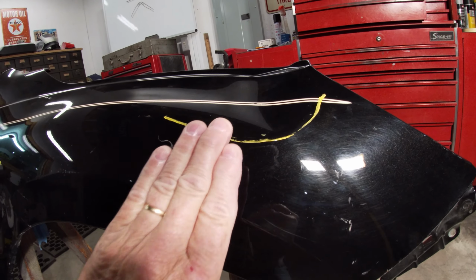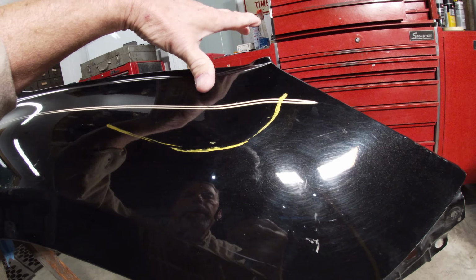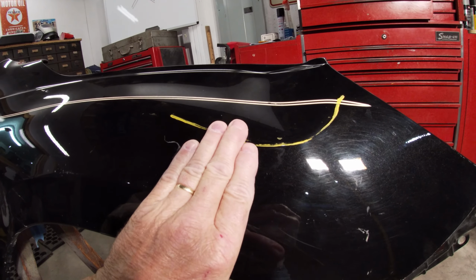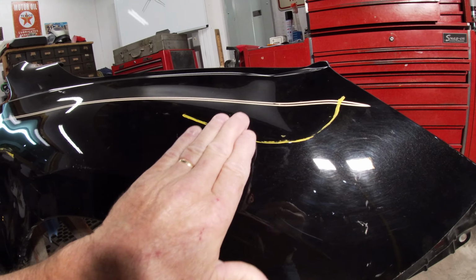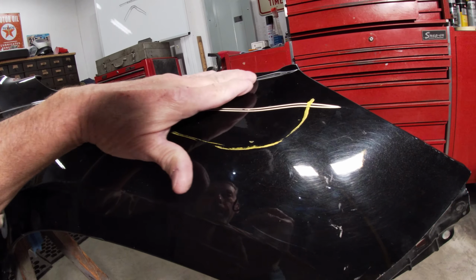This has to go somewhere and it needs to go back up into the dent. When this got buckled down, it forced that out. But it's kind of a double-edged sword because you can't get all this dent out if you've still got this in here. So you work on this most of the way, like I said, about 60%, get the dent out. Then you need to relieve some of the stress in here by hammering this down, then come back in.